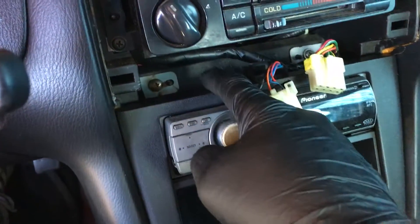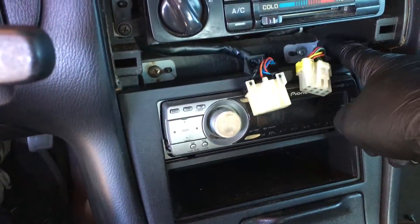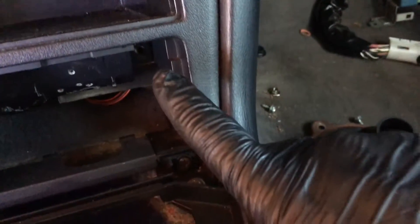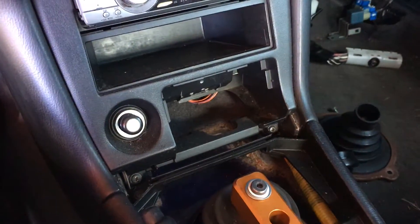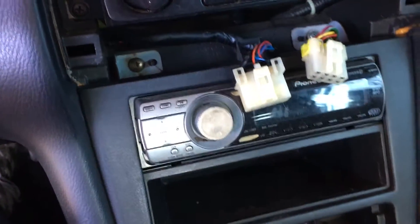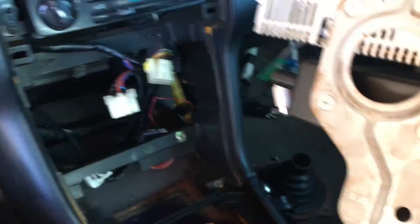For this piece we have two screws. For the bezel, we have a screw down here — in this case it wasn't there. And then we've got a couple screws down here. Once you get those bottom ones and the ashtray one, get the two top ones. I don't have the radio connected right now, so the whole thing will just slide right on out.